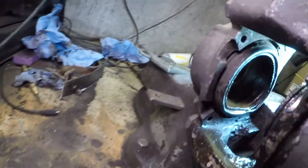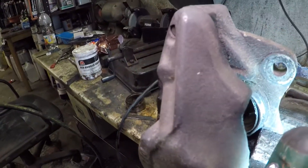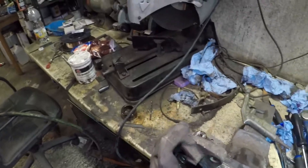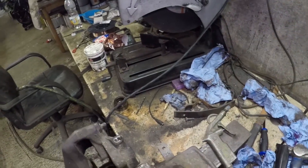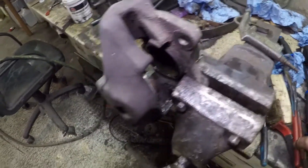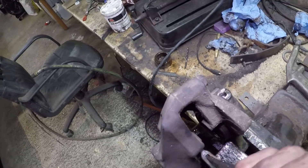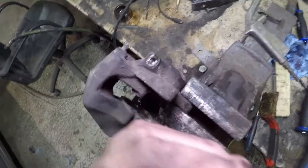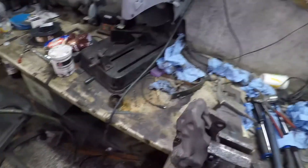The state of it — it's the crap coming out of these calipers. It's actually a good job getting them flushed out because they weren't nice. I'm going to keep working on this piston — he will come out, he is moving. He turns with the grips as well now, so it's just a matter of knocking him out gently and evenly each side. He does turn, so I will get him out, it's just going to take a bit more patience.